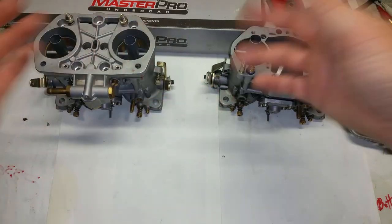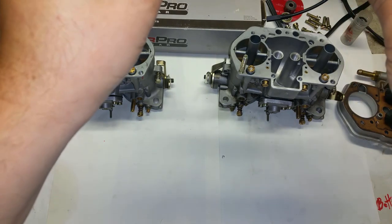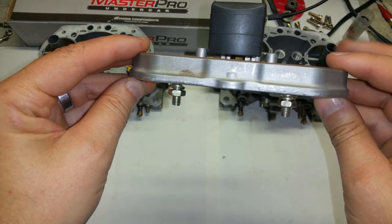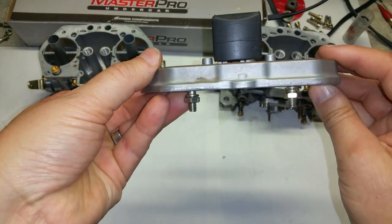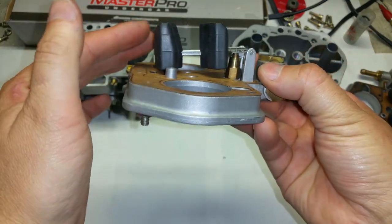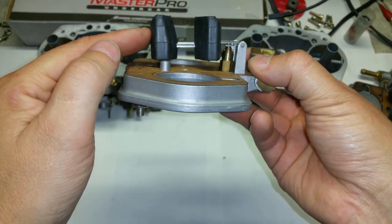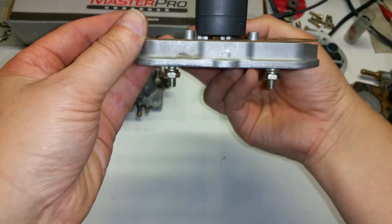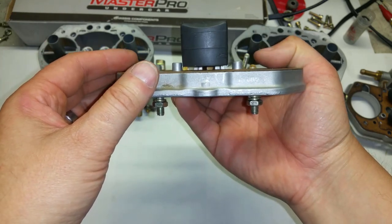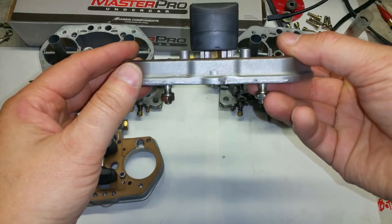I'll confirm the sizes with the digital caliper. This other one is all the way down - identical to our passenger side. This one looks like it's around 3 millimeters, calibrated the same Weber way - 14 mils, that thing barely touching the little ball on the fuel valve. I did not know this one was going to be really low and the other one really really high.